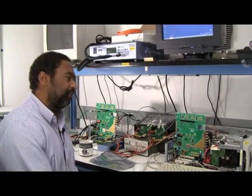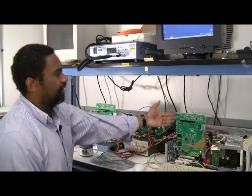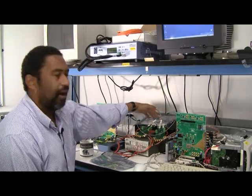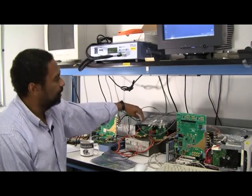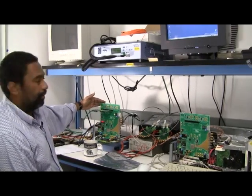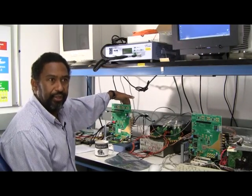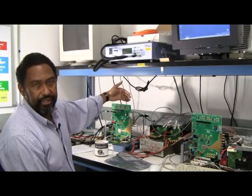Here's a demonstration of the host device. Here we have our Scout card located in the host. Here are the optical engines which will convert the electrical energy to optical energy. This second engine will convert the optical signal back to electrical. Then we move into our second Gen 3 card, which will hold an Ethernet NIC and also the SSD drive — that Fusion I/O drive, which also contains a PCI Express switch.